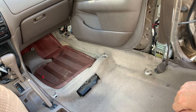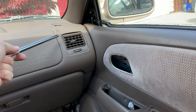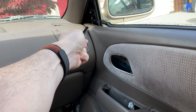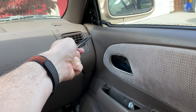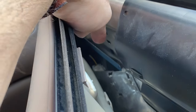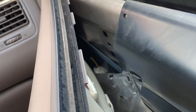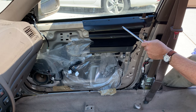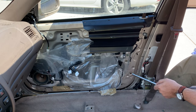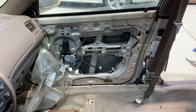The panel is held up near the dashboard where it's connected to the door itself with a screw you can't access from here — you need the door open to reach it. So I'm going to try putting a hacksaw blade in there and sawing through that screw to pull the whole panel out. Now that the panel is off, I'm going to take off this bracket here and this bracket here to give more access to the lock and the latch. That middle bracket may not be necessary but it gives a better line of sight into what's going on in there.